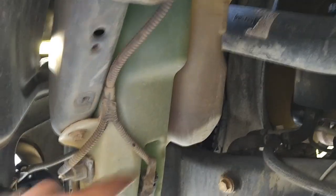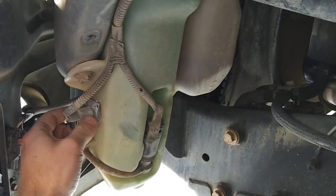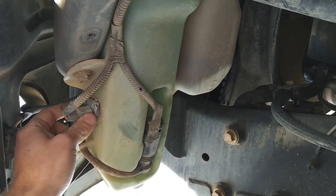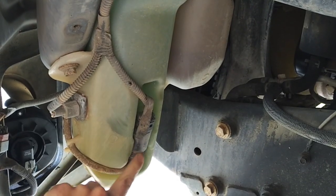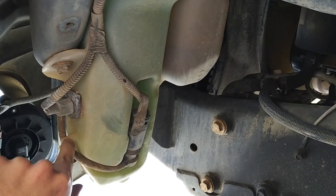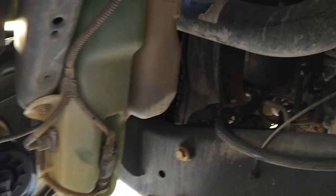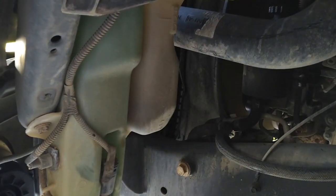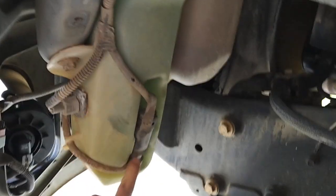The green stuff in it, that's our windshield washer fluid. We've got an electrical connector here — this is our low wash fluid sensor. Got another electrical connector that goes into the pump. This will end up pumping through the line here, and that goes up across the crossover cable for your batteries pretty much, and then runs along the passenger side and up into those things.